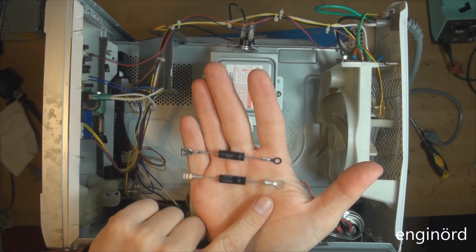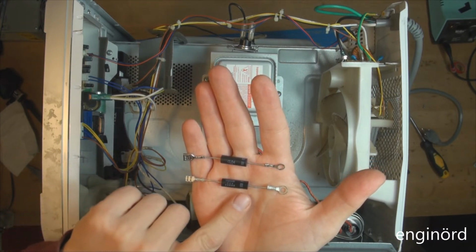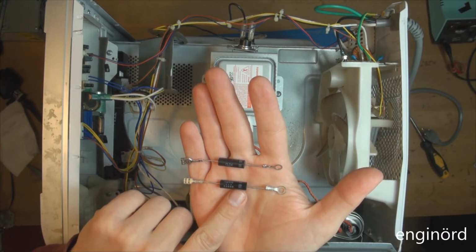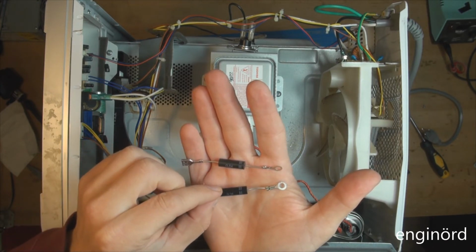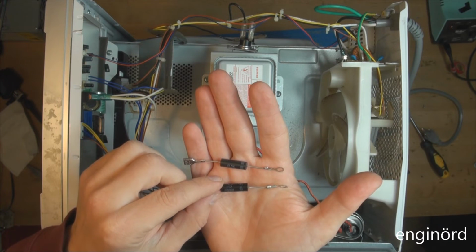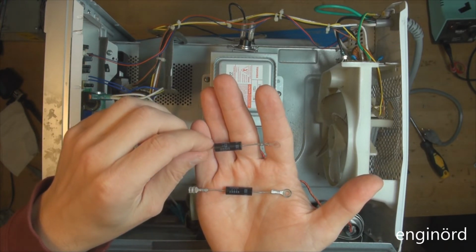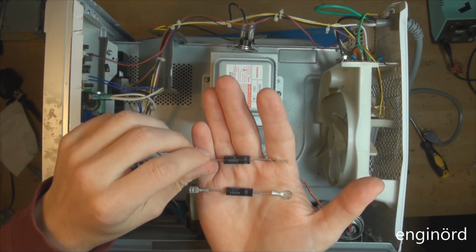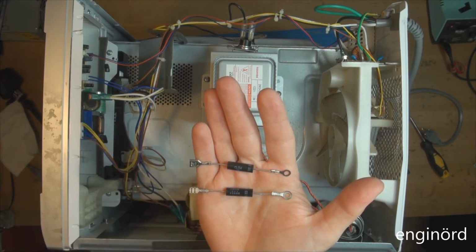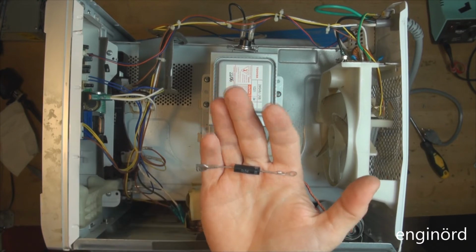It's got a ring terminal, it's got a spade terminal here, and it's got the marking on the ring terminal side, which typically marks the cathode on any of the diodes. And this one says CL0412 RG008. This says CL0412 RG910. So that's RG910, maybe that's a plant or a date code or something along those lines. But I'm going to go ahead and install the new diode.